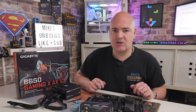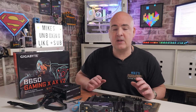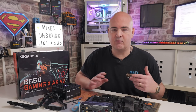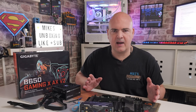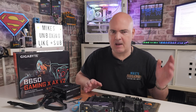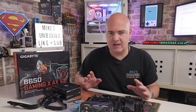Something you'll definitely need is access to another computer, ideally on the Windows ecosystem. You'll need that to go online to the Gigabyte website to download the BIOS, extract it, and rename the file. If for some reason you're unable to do that, head over to our Discord and let us know what motherboard you've got and we'll download the BIOS for you, extract it, rename it, and post it in the tech support section.